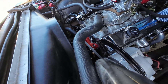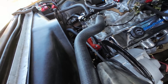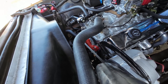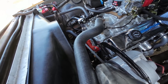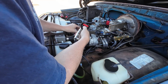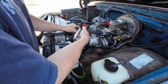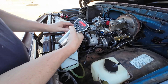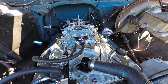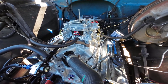If you don't have enough timing, it's going to be difficult to tune. I'm down closer to sea level and I always start with 12 to 14 degrees. The GMC truck is at 14 degrees before top dead center — that's my initial starting point. The engine starts well, idles well, has good vacuum — it's everything that truck wants. Is that where I'll leave it when tuning is done? Maybe, maybe not — I may add or take away a little depending on what the engine wants.